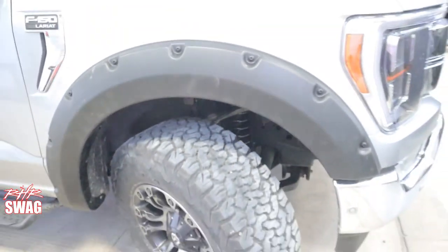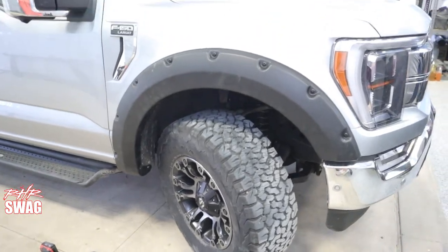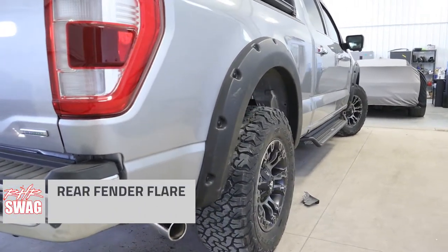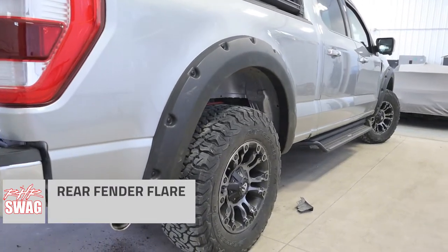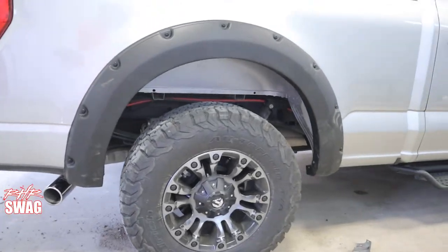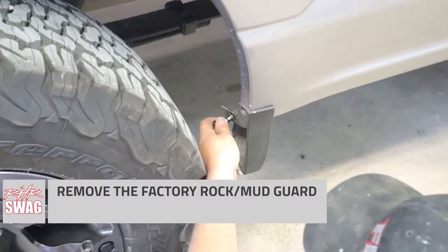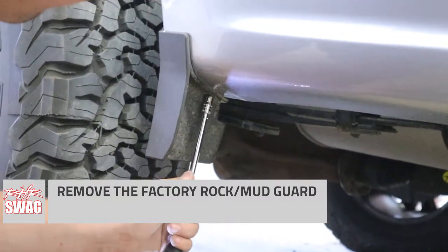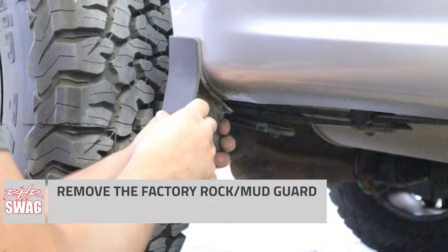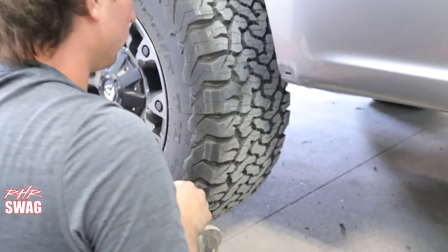There you can see the front and rear portion of our flare using just the factory hex bolts and the top part of the archway using the EGR quick clip system. Now onto the rear portion of our fender flare install. The rear install is very similar to the front. The only thing we're going to have to do here is totally remove the factory front rock mudguard. This does not work with the EGR fender flare, but you can still leave the bodyguard piece on the back side of the box as it works with the fender flare.